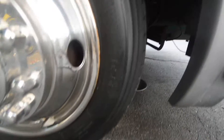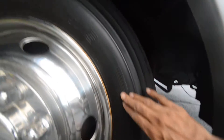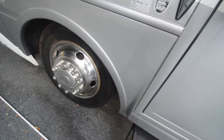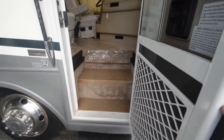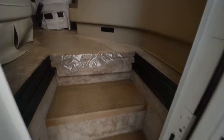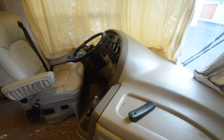Looking at the tires: there's a Toyo on one front and a Michelin in the back. The tires are not showing any dry rot or cracks, but they are 2006 date codes on the front, so they're about 10 years old. If you'd like new tires, that's going to cost you some money.